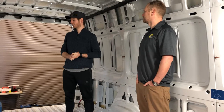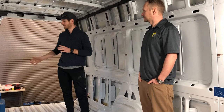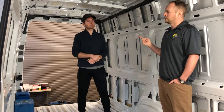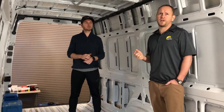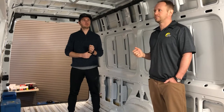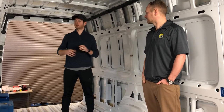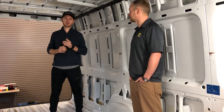So if you're going to build out your van and thinking about building cabinets, consider bringing in solar early and think about where the system's going to be. For this kit, we're talking a 30-amp charge controller with two 170-watt panels — that will be a 6-gauge duplex cable. If you thought you were going to do way more solar, the biggest cable we ever run is 2-gauge duplex. But if you just want to play it safe and give yourself maximum expandability, 6-gauge or 4-gauge on a van is plenty solid. You have really short routes typically compared to larger motorhomes.